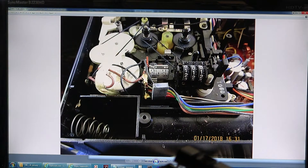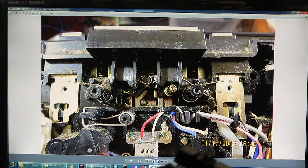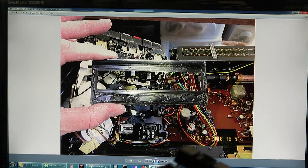Take it out, then unplug that. The stop button, and the fast forward and rewind buttons are held in place by one screw and a couple of detents. Then I had a heck of a time trying to get it out. Finally figured out this just was glued on on top, so that was how that came off.